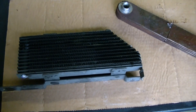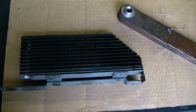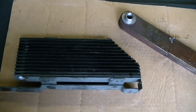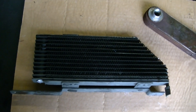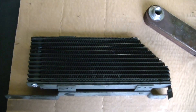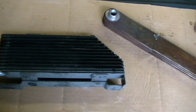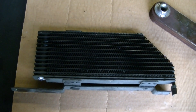I've got two types of transmission coolers here and I'm going to try to answer the question: can you successfully flush metal shavings out of them so that you can use them again after you rebuild your transmission? Recently I found that my 2001 Yukon's transmission pan was full of metal shavings way beyond the normal amount stuck on the magnet, so I had to rebuild it. The question comes up: what do you do with the cooler — can you flush it, or do you need to replace it?